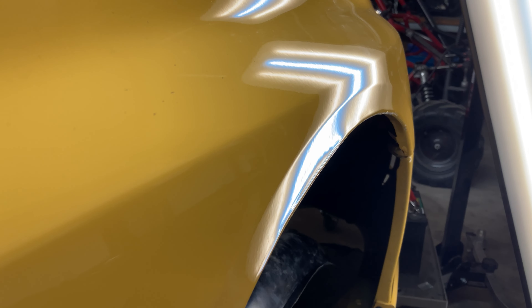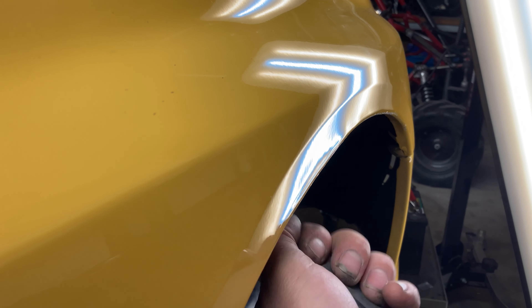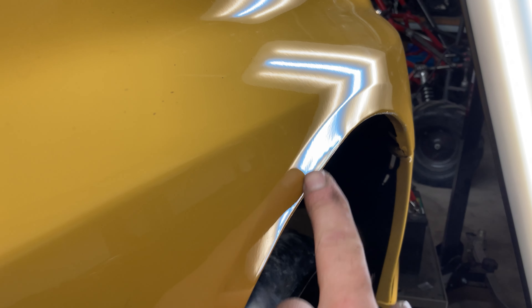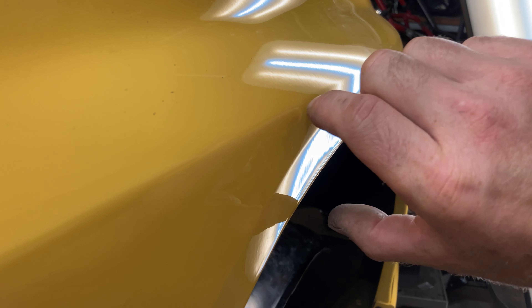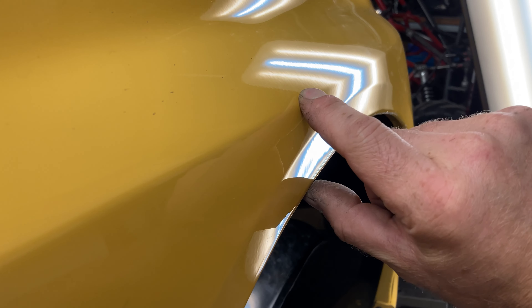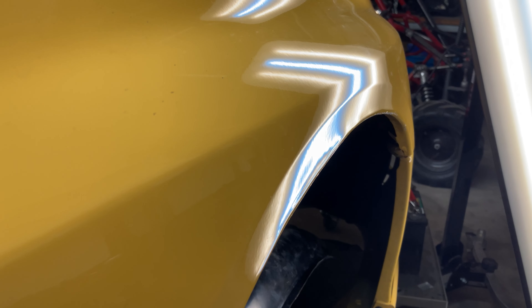Regardless, it has to come up — that's the plan of attack. If I was to not put pressure right here and just hit this up, there's a really good chance — I almost guarantee — that this is just gonna roll in further. This dip right here is just gonna go in further if I push that metal up. It would be like squeezing it together; it's gonna push that way because it's already going that way. Obviously the same situation with any car — if you pushed up there without holding pressure, you'd make it worse.